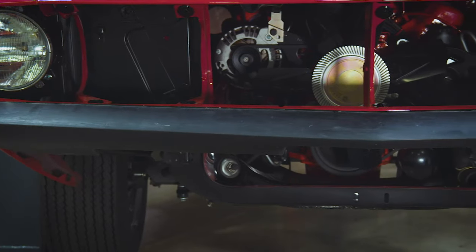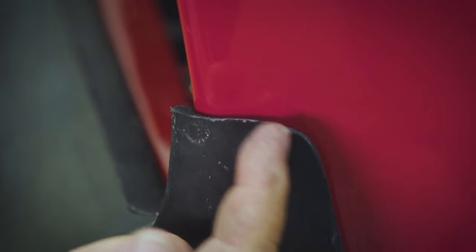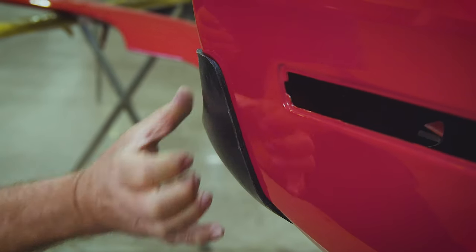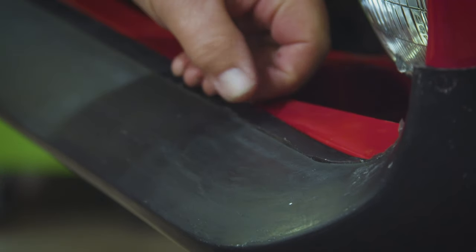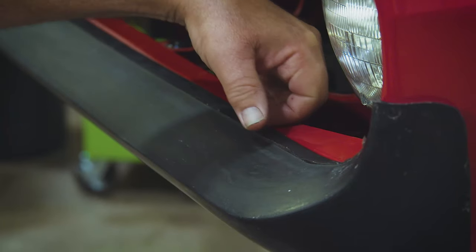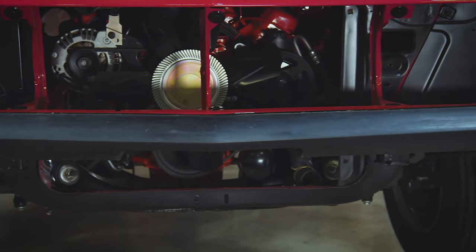One of the things the client wanted on this car was the rubber bumper option. It didn't start life on this car, but you could get it. There's a guy — Tommy the Crico — I met him at SEMA a few years ago and he said he was going to start making them, and he does. We pre-fitted it on the car and it fit better than the factory ones did. The original factory ones still had problems — a lot of times they weren't wide enough and they'd suck right up against the body, causing it to chafe and rub the paint off. This fit beautiful. Other than just finishing some edges that needed to be sanded out, it was a beautiful part. I gave it the green light, had it painted red and put on the car, and boy, it really does set off that car.